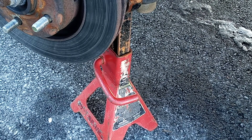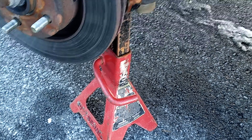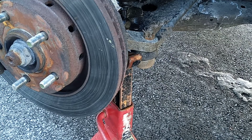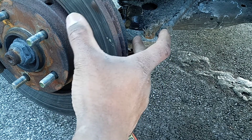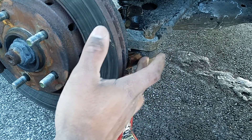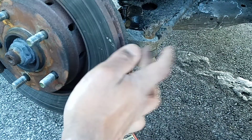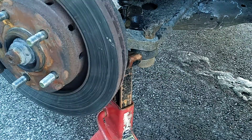Safety first — always remember to get a safety jack stand. You actually need a second jack stand. As you can see, I put it between the steering arm and the ball joint area. Just find the safest place to put a jack stand, because once you remove the control arm the wheel is gonna drop down. Always put this in before you start removing the control arm.